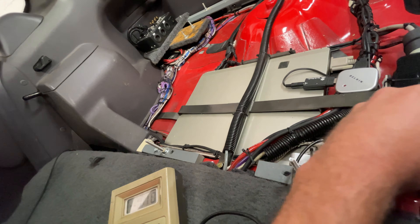What I've got to do, because I have this switch going to the front like I showed you, is take this little guy out and plumb it in here so that'll work. But first, maybe I'll just test this before I do anything to make sure it works the way it's supposed to. I'm going to manually turn it on here with the button. We've got power — nothing shorting out, key's on. That basically shows the voltage in, and that shows 115 volts out. So this is working — nothing's blasting or going wrong here. Gauges are still on. I think we've got it. You can see how this light's on now — that says there's power, which is my indicator.